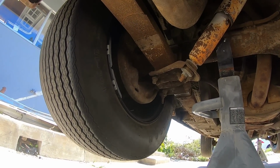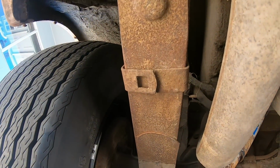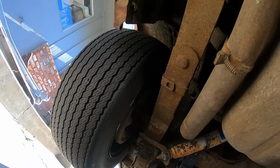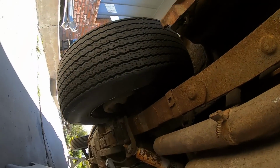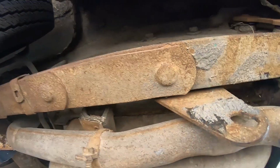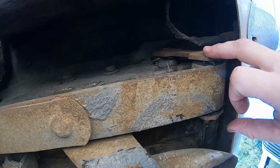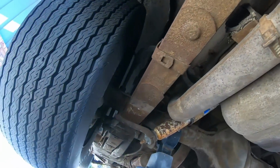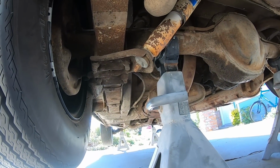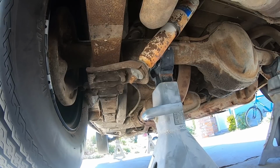And here is the driver's side leaf spring. Pretty looks original. That's something. Look at that. That's broken right there. These leaf springs definitely look like they're pretty nice. Not too pitted. Original rear shackles, it looks like. Haven't been replaced with any sort of crazy lift or anything in the back for bigger tires and stuff. So clearly never, I would say that's a good indication the car wasn't heavily drag raced. You know, I think the guy did drag race like I mentioned, but I don't think he did any crazy, you know, taking it to the strip and any kind of stuff.